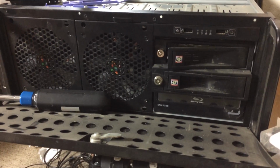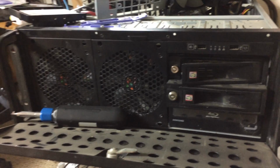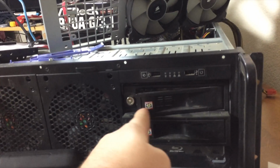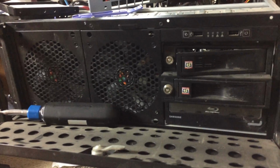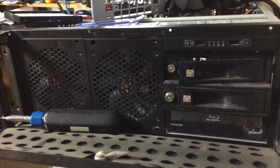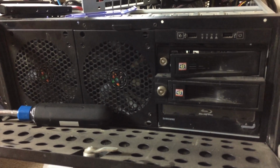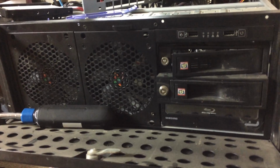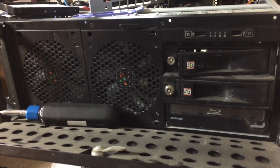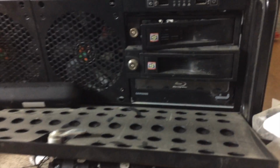The drive configuration, though, is changing slightly. I've swapped the OS drive to a 2.5-inch SSD, which I could mount in this using a bracket, but I'd rather have a couple sections of 2.5-inch hot swap bays available for that and the games drive, which I'm also going to be swapping soon from a 250 gigabyte SSD over to a 512 as well. I like keeping most of my game files local and not relying on Steam Cloud, primarily because of my internet speed.